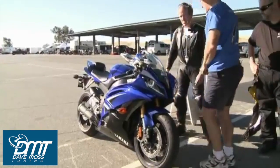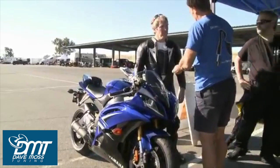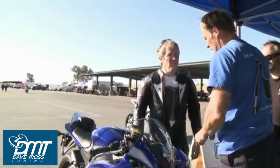There's your initial setup. Differences you will notice is that the back of the bike is a lot more compliant and the balance of the bike is even. So as you go through the turn, the bike will stay level. What you had before was deflection off every bump with the back of the bike. Plus, because it was so stiff, it's trying to drive the front wheel into the ground, not along it. So it dives for a corner. Now it will go where you put it.